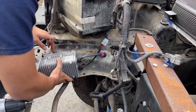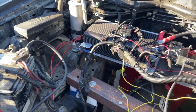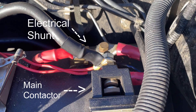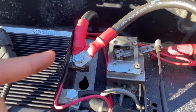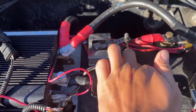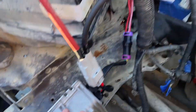Then I mounted the DC-to-DC converter right next to the 12-volt battery. It converts high-voltage direct current — such as the 135 volts coming from my battery pack — down to 12 volts, so that it can charge my car battery. After a bit of time, I got most of the wiring done in the engine bay. The positive line from the battery pack passes first through a shunt, then the main contactor. The contactor only allows power through to the motor controller if the 12-volt key ignition is turned on — this is how the car starts. Both positive and negative lines are connected to the motor controller, which sends power to the electric motor below if it receives a signal from the potentiometer. There is also cabling going directly from the main contactor to the DC-to-DC converter, which is how the 12-volt Jeep battery stays charged and all the other electric systems in the car work.